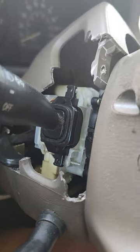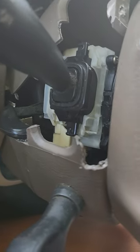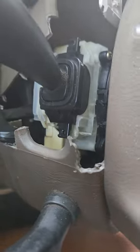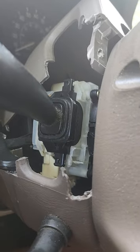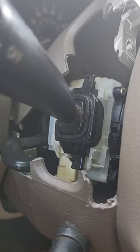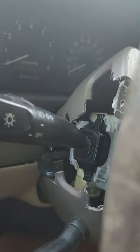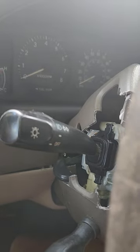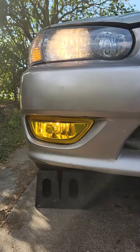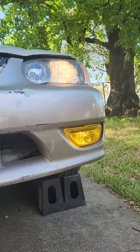There are better videos on how to take this panel off, but personally I don't bother. This car came with some broken parts — it was already broken and didn't have any screws on it. You're going to want to take these two screws off right there, plus some screws on the bottom, then take that off. Here's the switch — it just slides out, put the new one in, and there you have it, they are on.